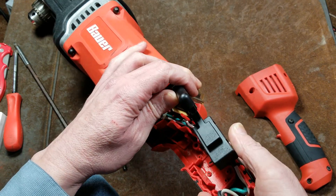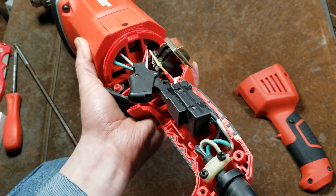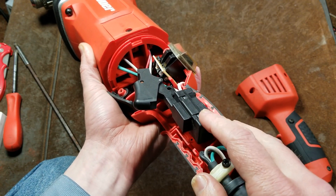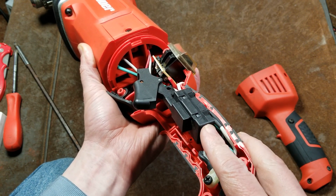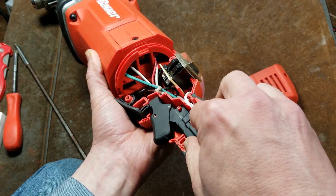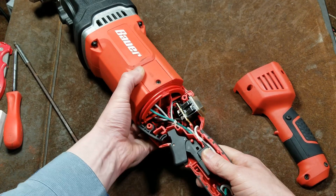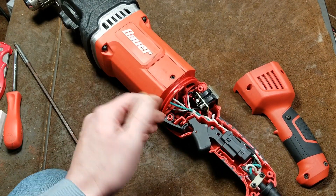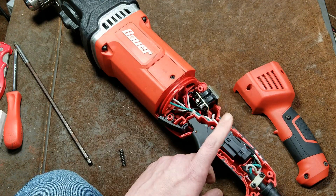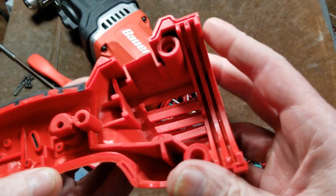Let me try to get a better look. It's a no-name brand switch rated at 10 amps at 250 volts or 16 amps at 125 volts. The trigger is properly rated but it's not particularly overbuilt. For instance, the traditional 13 amp worm drive skill saw will have a switch rated for 22 amps. This is a little surprising.